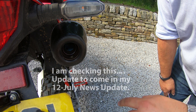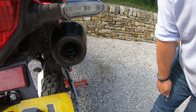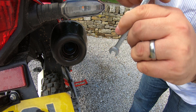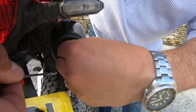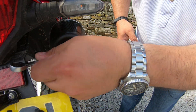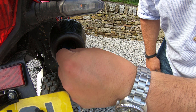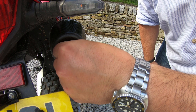There's actually a mark in the end can on the carbon fibre — a small hole you might not be able to see, and that's the first build quality issue I've noticed. Using an 8mm spanner since my socket set is slightly too big. I need to be careful not to lose the lock washer and not to drop the bolt on the gravel or down inside the muffler. That bolt is now out.